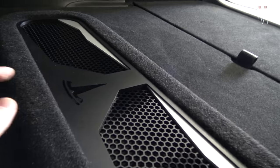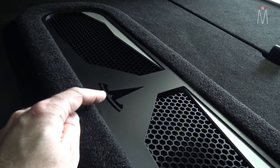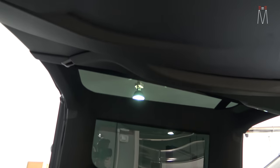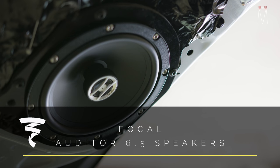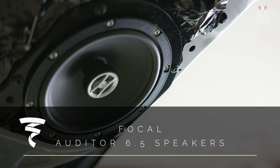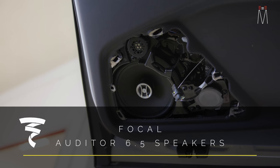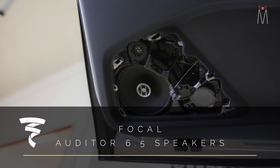I also didn't mention we did a Tesla logo here — it's its own piece of quarter-inch acrylic kept in shiny black, while everything else is matte black acrylic. As far as these rear speakers go, we just did Focal Auditor — something entry level. The rears aren't really necessary when it comes to great audio; we spend our money on amplifiers and the product up front before thinking about spending a lot of money for the back. Also, be very aware of how much sound treatment you're putting in these doors, because they motorize — they are on a limit and will not open if you put too much in there.